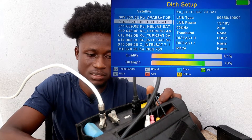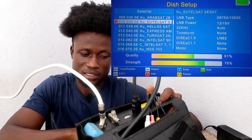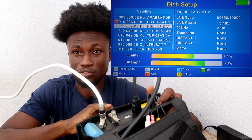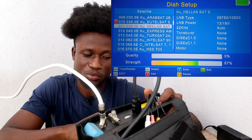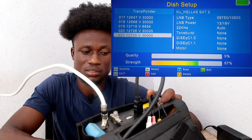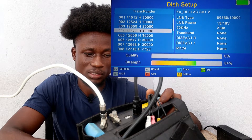I've already scanned but I'll show you how to do it. Select the DStv satellite, go to Transponder — every decoder will have a command there, so look at the command and go to what you want. Press 'Go To' on my Finder. I've already saved the DStv TP so I just search from the list and select it.